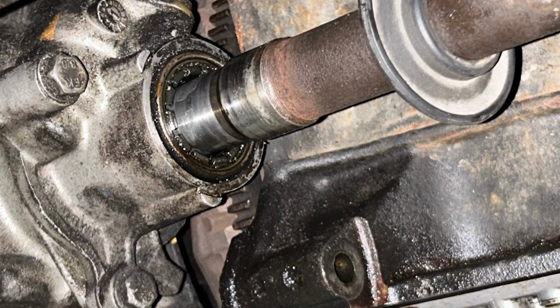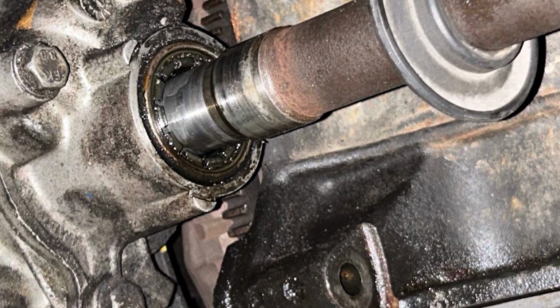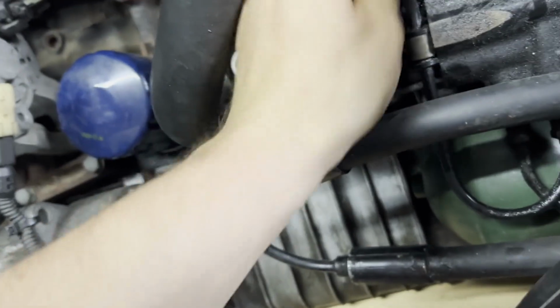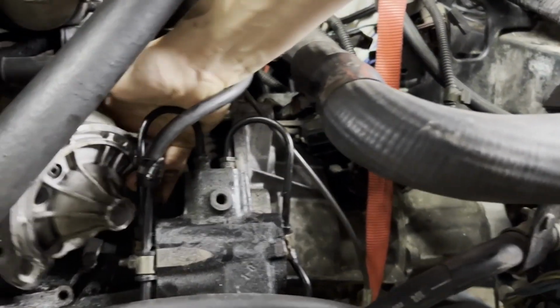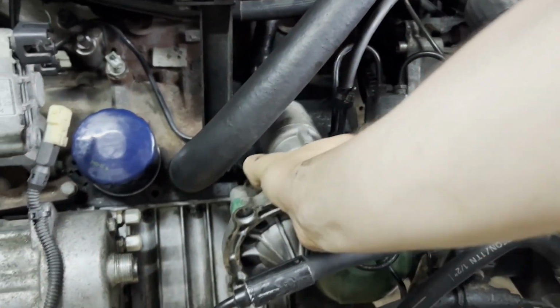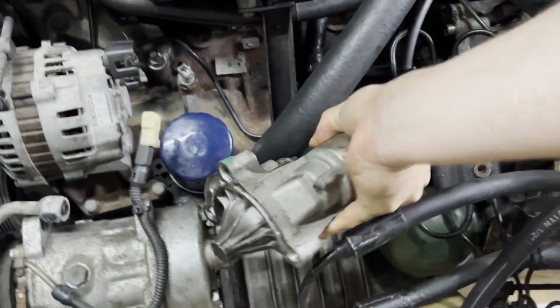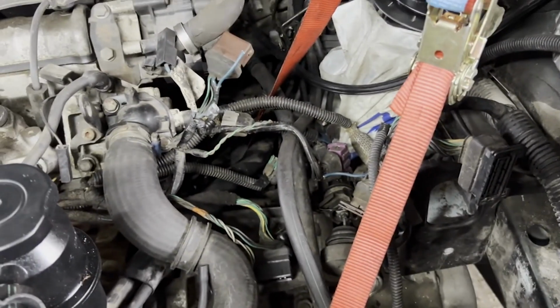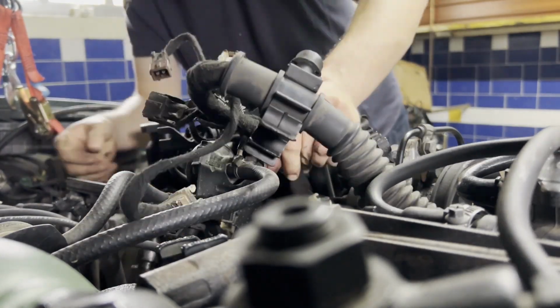There isn't footage of this, but there was one weekend that my father came to visit and he actually helped me with this, and it turns out that the amount of slack from pushing the gearbox was enough to actually remove the drive shaft. In theory, we could remove the starter motor before it drops in our fit. In theory. Let me just turn it around. Yes. Now, as you can see, actually you can't see anything. We still have to move this engine wiring loom out of the way. And we'll really have to do this, which is annoying. Now this is completely separated. Thank you very much. And we can just remove it. I think you can see how fiddly this is from that angle.